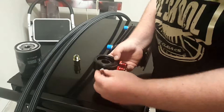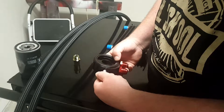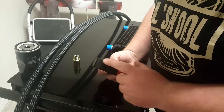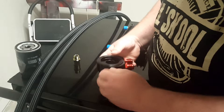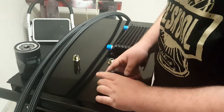We also have two blind holes here at the sides, covered up with blind screws, so we can mount — in my case, I haven't received it yet — an oil temperature sensor and an oil pressure sensor. You can mount those here, or you can just leave it like it is and just use the radiator by itself.